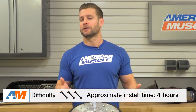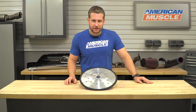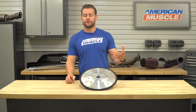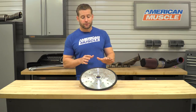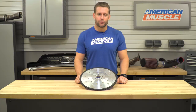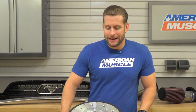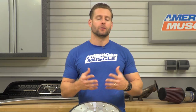You're gonna need a good set of tools to tackle this one, in addition to a lift — I would highly recommend one if you have access, because doing a transmission or clutch job on your back is never a good time. If you've never dropped the transmission before, it's really not the hardest job in the world, but there are a few steps that can make it a little tedious. You'll need to drop the exhaust and driveshaft along with removing the physical transmission itself. Once everything is out of the way and the flywheel is exposed, removing it along with the clutch is pretty straightforward. When installing the new flywheel, make sure you have some blue Loctite or thread locker on hand along with a torque wrench so you can torque the new flywheel down to around 70 foot-pounds.